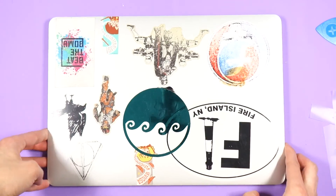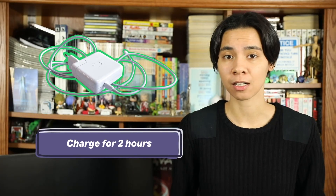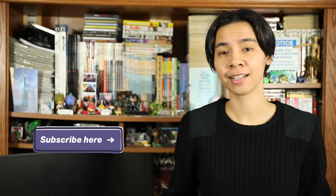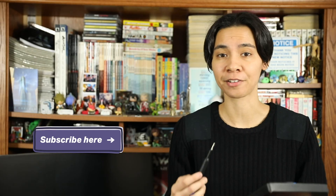With the new battery installed, plug in your laptop's charger and let it charge fully. Give it two hours to charge, even if it hits 100%, because it'll help calibrate the battery. Once that's done, use your laptop and let the battery drain normally. If this how-to helped, please give us a like. And if you're looking for more tech how-tos or to learn something different, be sure to check out our how-to hub and subscribe. Your next project might be right here. Well, I gotta get back to sorting out my tools, so I'll catch you guys later.